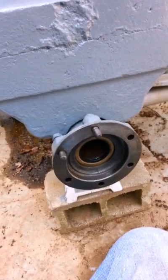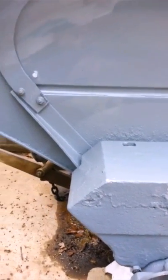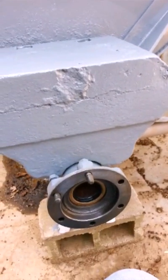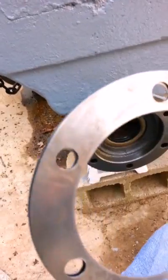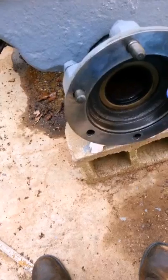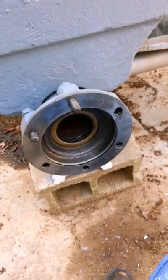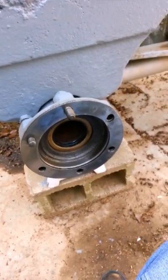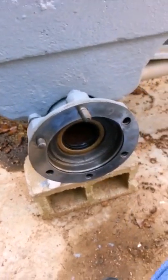It's time to begin reassembling the components back to the tractor itself. As you can see, I've coated everything with some paint to clean things up. First thing is, there's a couple of shims that make sure the axle, when it enters the rear end, just touches the other opposing axle. Since the bearing and collar wound up in the same spot, the two shims that were there should be all that's needed.